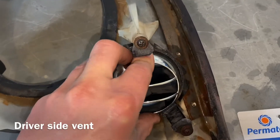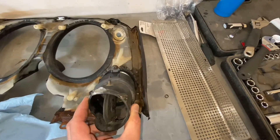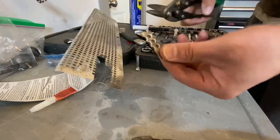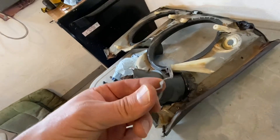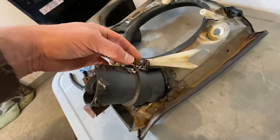Now we're going to move on to the vent that's cracked — the driver's side. You're going to push this ball in really tight so this can go in. As you can see, the problem here is that parts of this cracked — right there, right there — and there's even a chunk missing here. Okay, so we got that ball in and now we're going to put this thing in like this. See how it all lines up nicely. And then we got this type of metal — we're just going to cut little strips out of this with some snips. Out of that I made something like this. It's pretty stiff, very stiff — I have to use pliers to bend it. We're going to make three of these and screw them in, just like that.